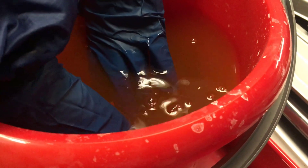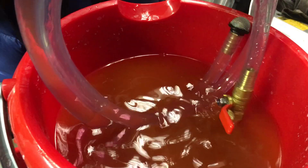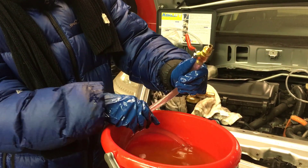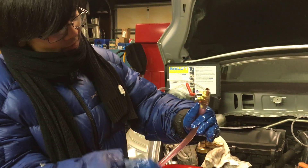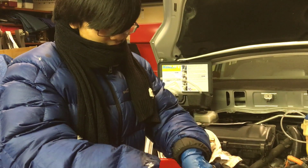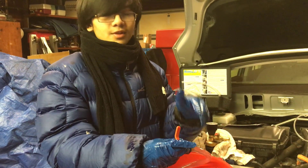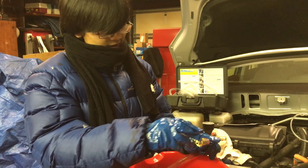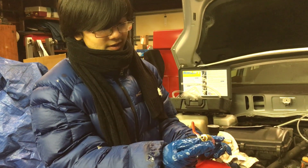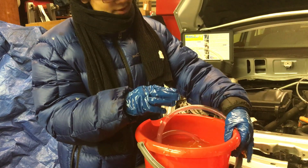Just roll up your sleeves in case. Finally, we're going to close it. Make sure you submerge it entirely — open it and close it, just to make sure. We got air bubbles. So we finally have all the coolant filled in the hose. The strategy is: continuously put it down, shake it a bit to get coolant in, then raise it out of the water to let the coolant at the top go down to the bottom, and continuously do that until the whole hose is filled. You'll see air bubbles coming out of the end of the spout as the air leaves the hose. Make sure the bottom doesn't leave the bucket or the coolant, because you don't want air bubbles in there.